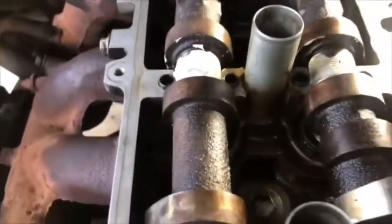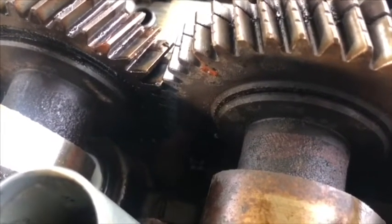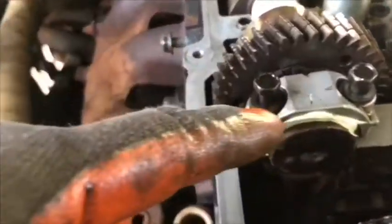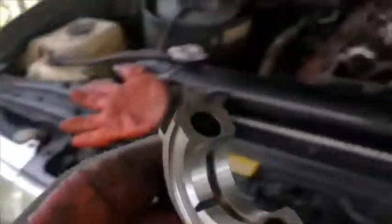Okay, we start putting in the previously lubricated camshafts so that they do not have problems at the moment of starting. An important thing when putting in the camshafts is to be careful that the shafts have synchronizing points on the back. The orange mark has a point on each side, and the marks coincide. It sits a little bit out of phase due to the pressure of the valve springs, but when they rotate, they coincide correctly. The rockers also get grease. They are already marked from 1 to 7, and the part on the exhaust has a mark, and the part on the intake is marked forward.